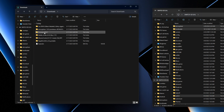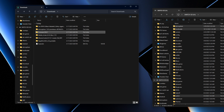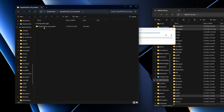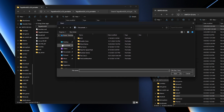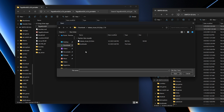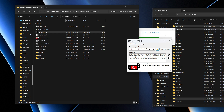Open the firmware folder and confirm it looks correct, then drag the firmware 20 folder to the root of the SD card. While waiting for any remaining downloads, open Tegra RCM GUI, click the folder icon, go to Downloads, and select the Hekate payload file.